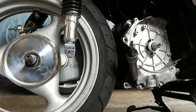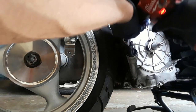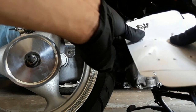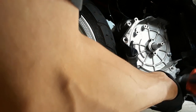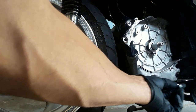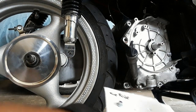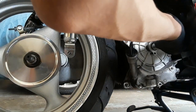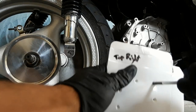Now we're going to go ahead and take off the cover. We have 8 millimeter — seven bolts that we'll be removing right now. We want to use our handy slot holder to keep the bolts organized. I'm going to do this in a cross pattern just to make sure. As you can see, the screws are different sizes, so we need to track which goes where.